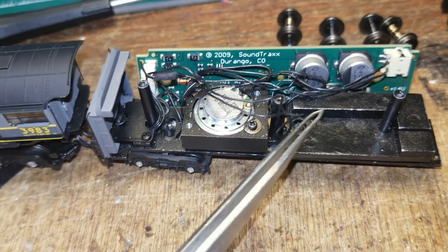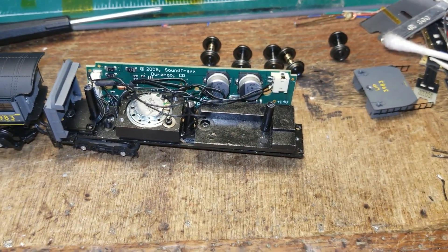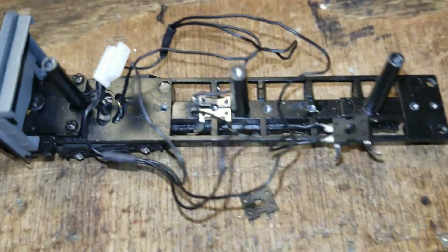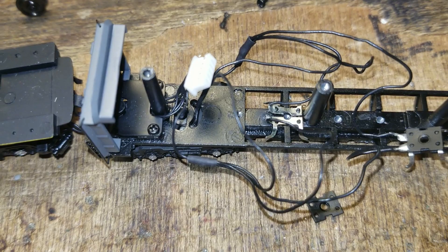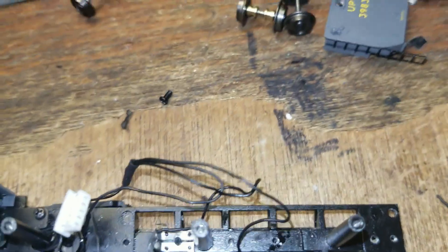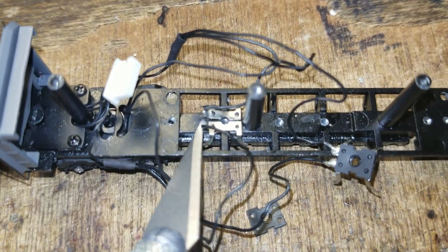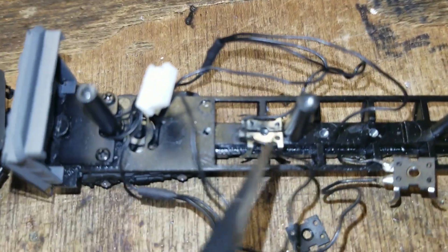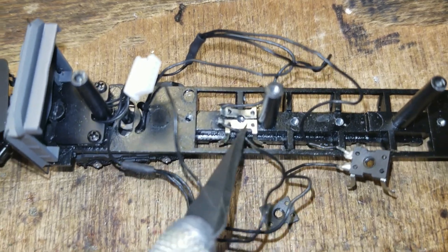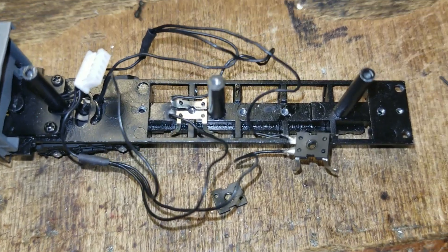So that we have appropriate pickup from those wheel sets, then we'll start moving into other aspects of the locomotive — I'm sure this will be a huge time suck. In pulling this apart to re-bend the contacts, one interesting thing is this whole pickup is supposed to come apart like a sub-assembly, but the one next to it somebody had glued from the bottom — probably the factory, because that's crazy glue. The top cover came off but I can't pop these off easily to adjust the contacts.